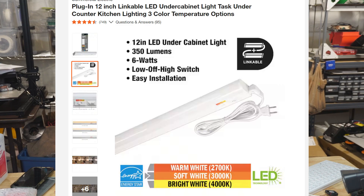On the ceiling of the enclosure there are two things: a fire safety device and an LED lamp. The LED light is a simple $24 under-cabinet AC-powered LED lamp. You can get those at Home Depot, Lowe's, or any box store of your choice. In the past I used LED strip lights, but over time the glue would fail and they'd start to fold up, so the lamp has worked way better.